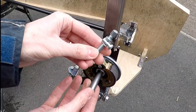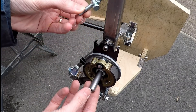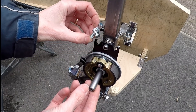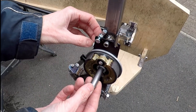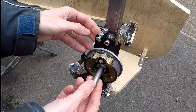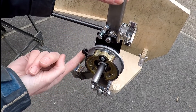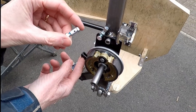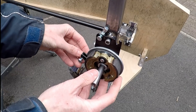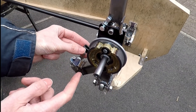I've got a couple of these things, one left, one right. I can't remember what these are called, but basically what they are is the cable guides for the drum brake cable. Slots in like that. I'm a little bit disappointed with that fit actually, it's a very loose fit. I'm not quite sure if I can do anything about that but I'll have a think about whether I can add a spacer or something to lock that in place. But anyway, it's not going anywhere — the brake cable will go down through there and attach to the other end of that arm there. And these things are the cable locks, so the cable will go through that hole there and be locked off by screwing that up. And that fits in the bottom of the braking arm like so. So that's how the drum brake fits on. The left hand wheel fits, naturally enough, in exactly the same way.